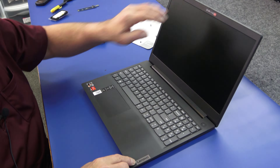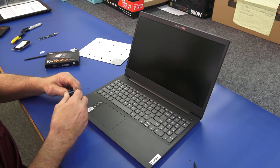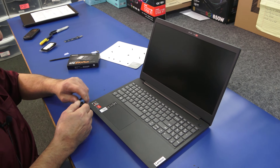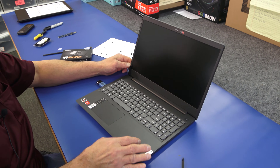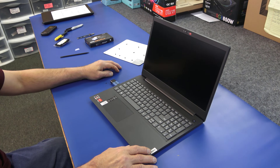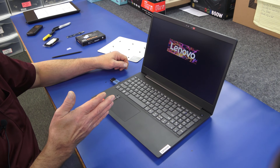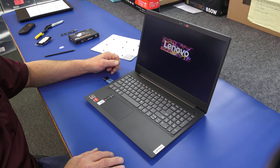So now let's open it up. I'm going to use a USB drive with Windows 10 on it — you can make one of these for free, just download the Microsoft Media Creation Tool. I'll have a link down below and a video on how to do that. So I'm just going to pop it in a USB port and it should default to that for booting. If not, we can get to the boot menu. I'm going to go ahead and power it back on and do a clean install. I got my bootable flash drive in there. The computer should default to that for booting because we've got that brand new bare drive in there.